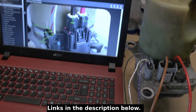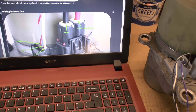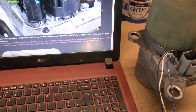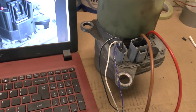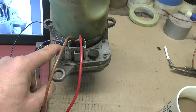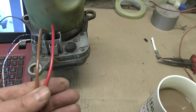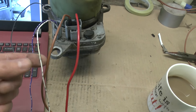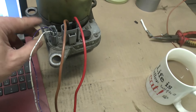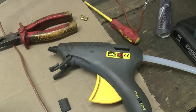This is the website where I got the information on the power steering pump that I've got. Hopefully this is correct — I can't be 100% sure — but it all looks correct. Similar connectors and so on, showing as 12 volt positive, fused ground. I believe all I need for this to make it work is 12 volts on the main heavy current wires, and then supply 12 volts on the ignition wire. The CAN bus wires will be optional and I'll add them at a later date. The hot glue gun is just warming up nicely.